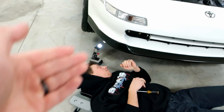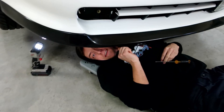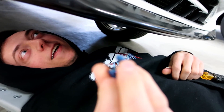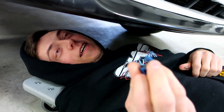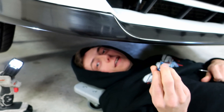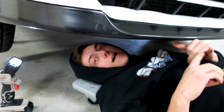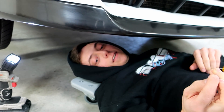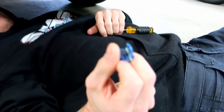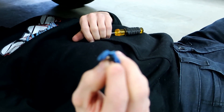We got BB here and I was looking at electrical, but of course as I'm eating, he can't wait — he's like, I got to tear into this. So what'd you find already? It turns out that they disconnected the factory fog light harness and hardwired it into the turn signal so that the fog light would constantly run, whether you're on a high beam or low beam setting. And over time, this connector took a toll on the wire and just shot it out.